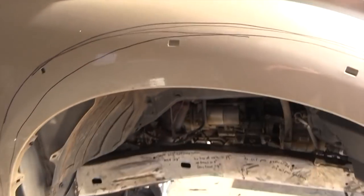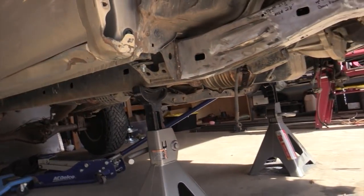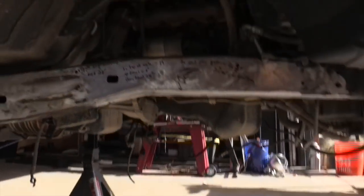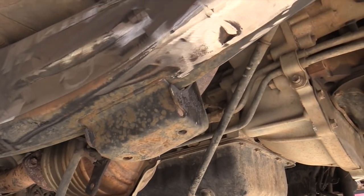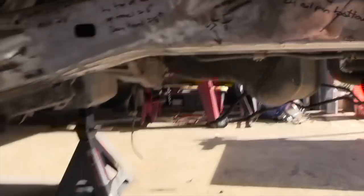Made a little bit of progress today. Ended up running around town — had to go get more gas for the welder. Was supposed to go pick up the steel for the links today, but it didn't come in because the truck got delayed in traffic in California. In the meantime I have some thin-walled steel I can use to mock up if needed. Progress so far: body lift is off, bolts are back in for the body — got a couple that are kind of the wrong length but it'll hold for now. Still gotta grind off the sway bar mount here, and I gotta swap the oil pan out today.